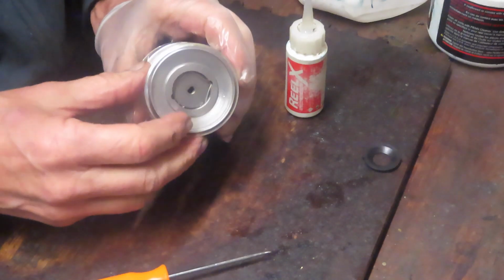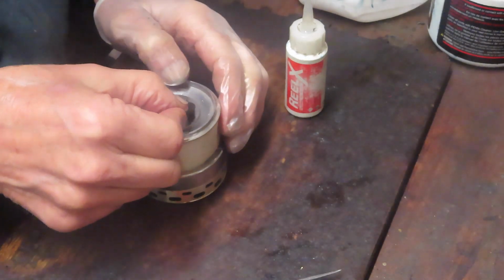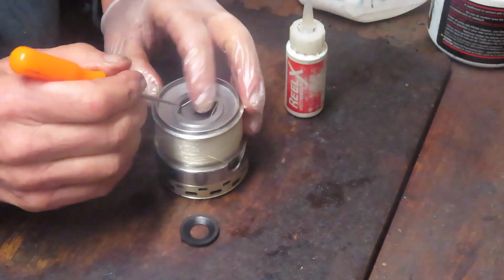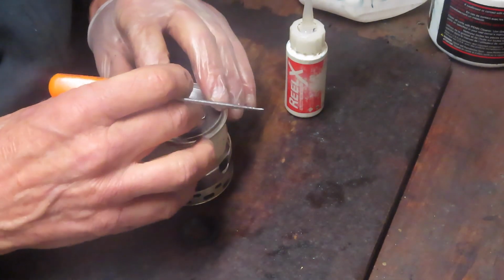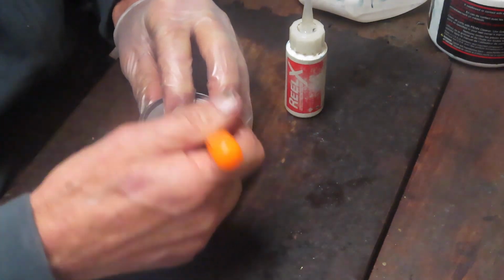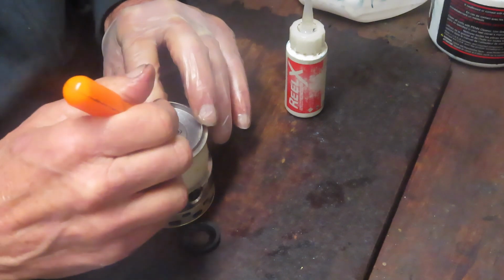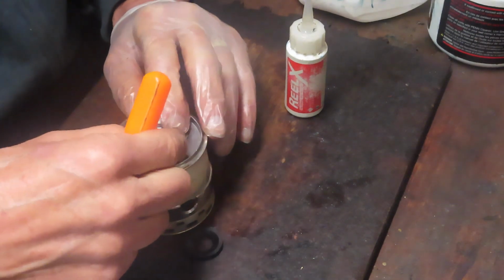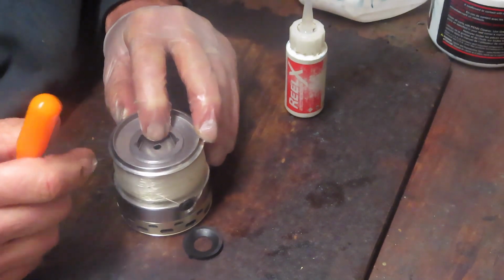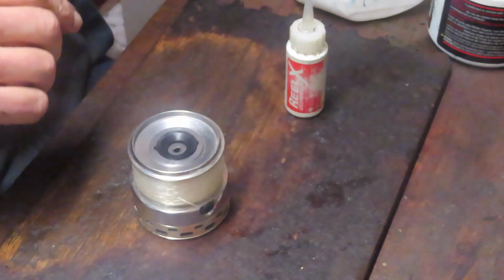All right, you want to just make sure that those springs are in the clip grooves. I'll just go ahead and put this back on. Yep. So one of the things you need to do here, you can't have that spring where that little rubber grommet's going to go. So you just need to pull it out, move it over a little bit, reposition it. It seems like it just wants to go in that hole there, doesn't it? If you don't put it in where you have that clear hole, and these studs on the seal are not going to sit properly. That's it. Go ahead and put this back on.